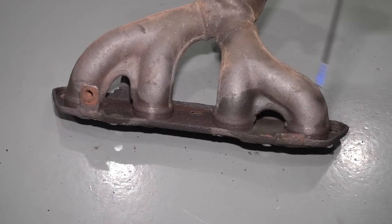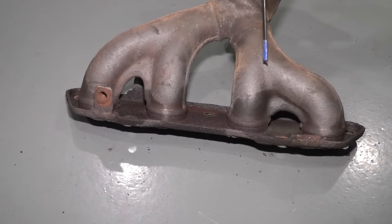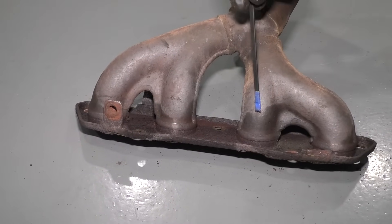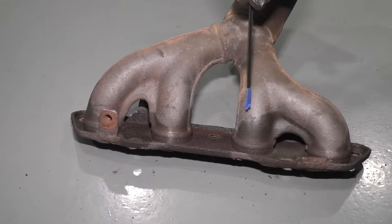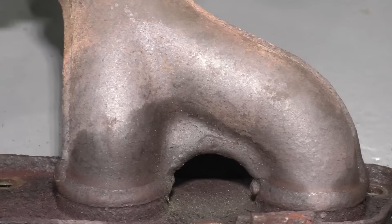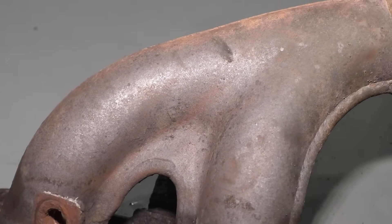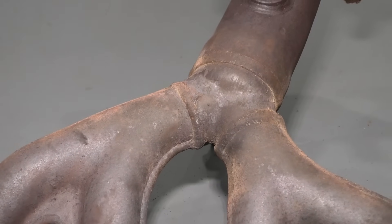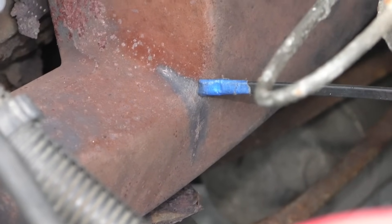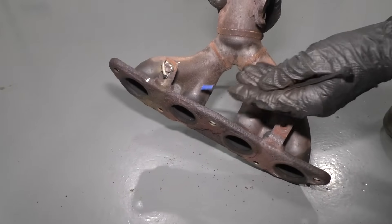Another reason why you might find a leak on your manifold could be a simple crack. A lot of times they're going to be hard to see because more than likely you're going to have shields over your manifold to help dissipate the heat. Behind those shields, what you'll oftentimes find is a tiny little hairline crack, maybe along the tube — generally along a curve of some sort. You might find it in between areas where two parts come together or even along one of the bends. If you happen to see something that looks like a crack, it probably is. You might also see a little bit of black or even white along those cracks. Check out your whole manifold, turn it over, and do the same on the reverse side.